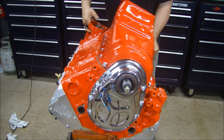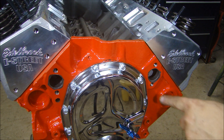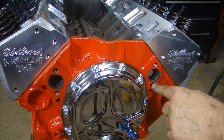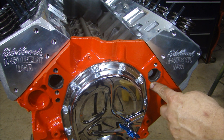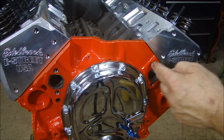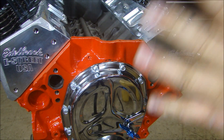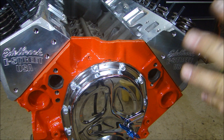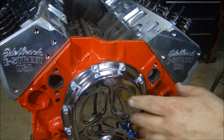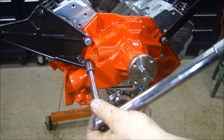Oil pan is on. We'll flip it over and put the water pump on. One thing with the water pump: this bottom hole here is a through hole — it goes all the way into the water cavity — so you have to make sure you seal this thread here with some silicone sealant, or I'm going to use my Right Stuff. The other three holes are blind holes, so you don't have to worry about those. I'll put the water pump on, put my gaskets on, and bolt it up. The other thing is there are brackets that go with this, so you want to put the bracket on now so that you don't take the bolt back out and risk causing a leak path. Torque these down to 45 foot-pounds.